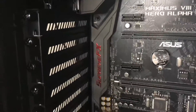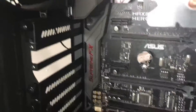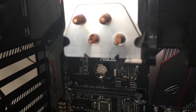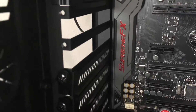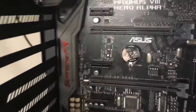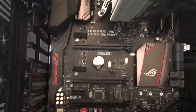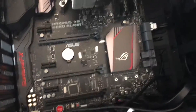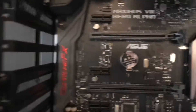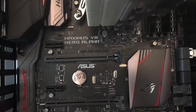Alright, so now that we've removed two of these slots, I'm just going to place the graphics card right in there. I think I'm actually going to turn my PC over just so it's a bit easier to reach inside. I'm going to take the plastic coverings off first. And we're just going to slide it into this PCIe slot. Alright, it goes that way. So I'm going to put my PC sideways just to make it easier. It won't bend at least a bit when you're putting it in until you screw it in.